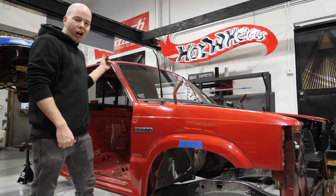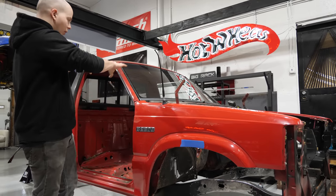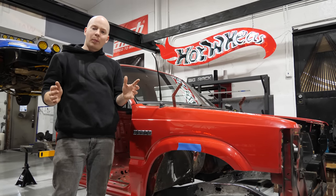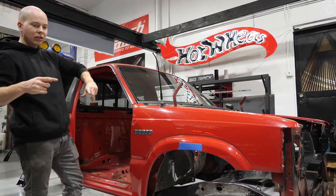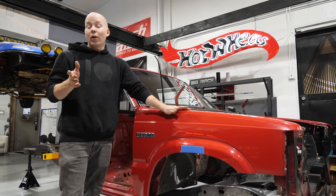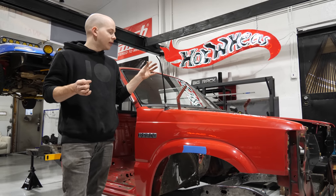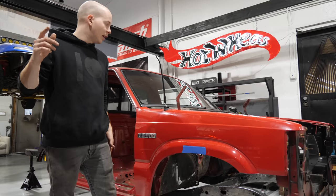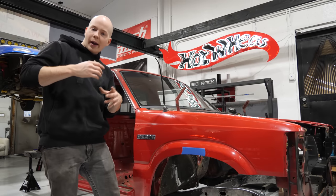So we got the truck off the lift, rolled forward into this open area, and on jack stands nice, perfectly level in all three dimensions. Got the fenders put back on. Now we can start working on getting the jig put into the right place. First step, find the center of the fenders like we did on the 240, and then kind of work backwards from that.